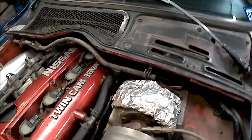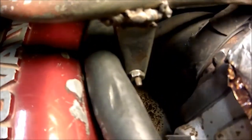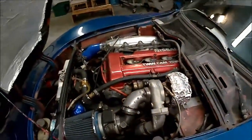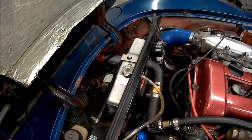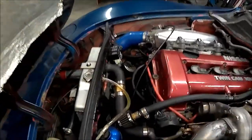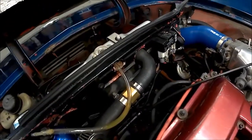Going around to the other side of the turbo — a little hard to get it lit up underneath there, but there's the exhaust stuffed down there past the transmission. The hardest part about this swap is fitting the turbo and the exhaust in, and in this case it all fits underneath the hood. We're also running a Honda Civic radiator — these things are great for engine swaps, nice and compact, good size. It's positioned just barely in front of the radiator support to give a little more space to work on the engine and allow a little air circulation.